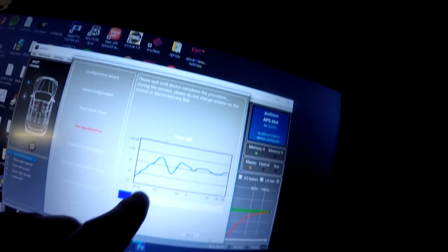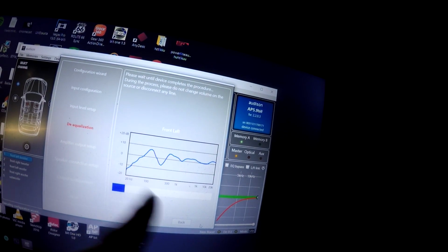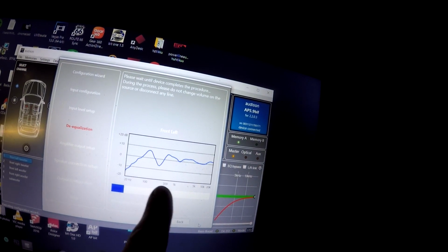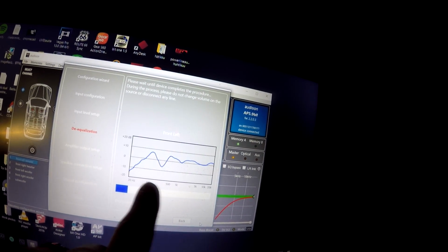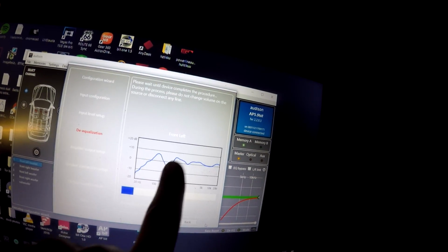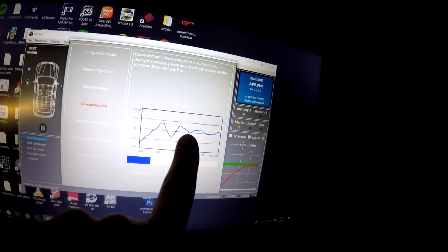With this we can actually see that the OEM head unit starts to cut from 100 Hz down, and it has a very low peak here at around 250 Hz. This is a range where people normally speak, from maybe 200 to 300 Hz up to 1 kHz. So this is audible, like songs that are coming.